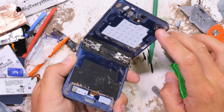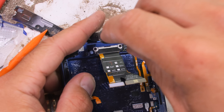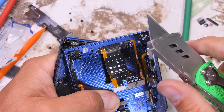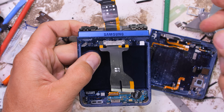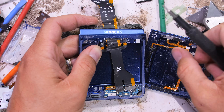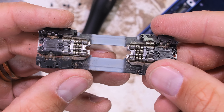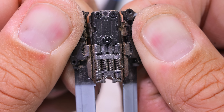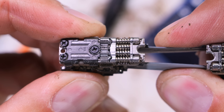Finally, it's time for the hinge. Samsung has redesigned this thing again this year, this time calling it the Armor Flex Hinge. Samsung says it's more drop-resistant than the previous design while having a tighter folding radius and dual-rail architecture. Removing the 4 screws along the spine and 8 screws along the upper half of the phone, I can pull the upper half away from the hinge. Assembling this in a factory has got to be a work of art — there are so many more moving parts and complex procedures than a normal smartphone. I'll remove 8 more screws holding the lower half to the hinge. Since we removed the spinal screws earlier, the Samsung logo can fall away, revealing the new design. We still have springs and gears like we've historically seen, just this time around we have 4 sets of everything: 4 gears and 4 springs on each side. Still slathered in dust, though.